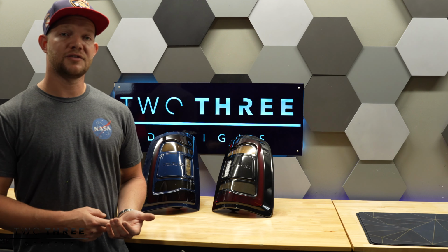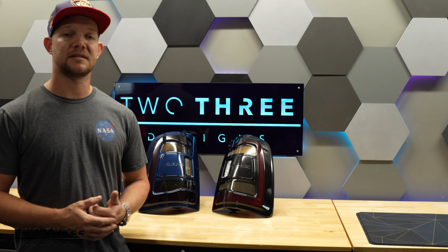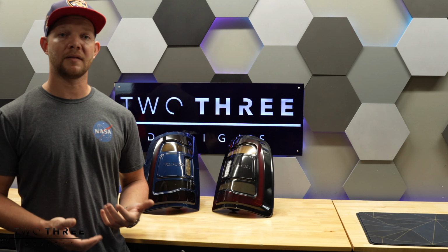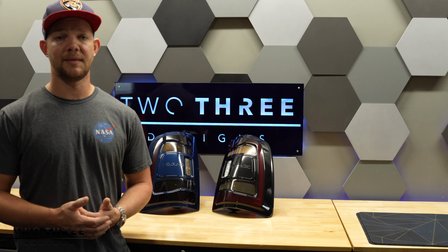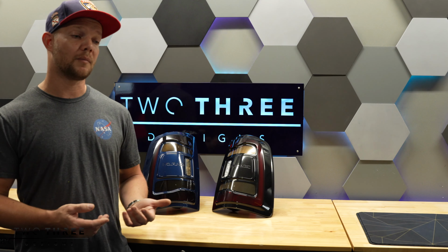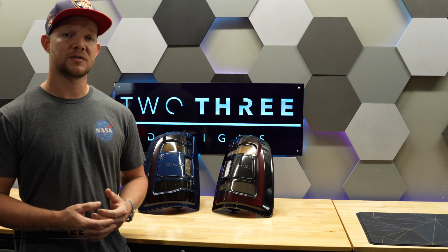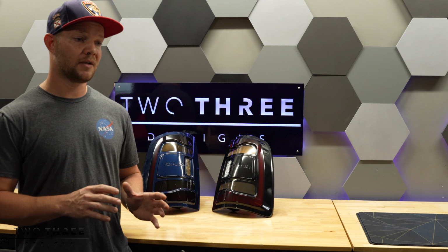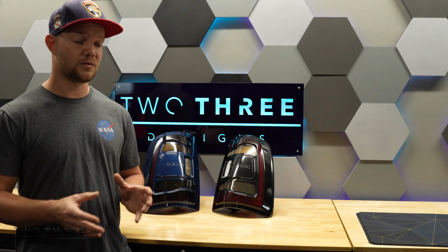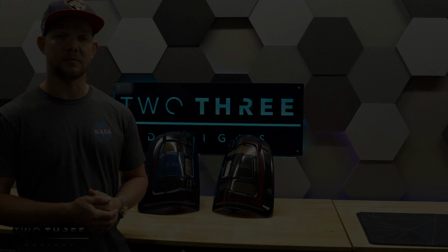What we found on these trucks from 19 to 23 now is that there are small variances and features in the blind spot monitors. So the easiest way for us to go about this and keep track of everything is for you to keep the sensors that came on your truck and do a swap when the taillights arrive to you. So I'm going to go over how to swap out the actual sensor itself. When you receive these taillights, you have 6 screws to install on each one. Swap that sensor into the new taillight, send us yours back, and you'll be good to go.